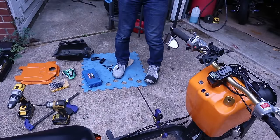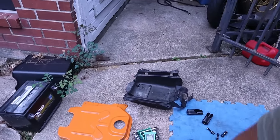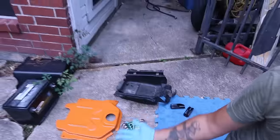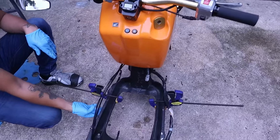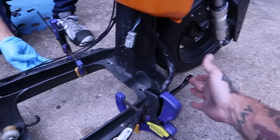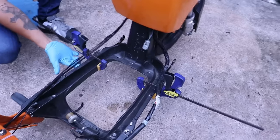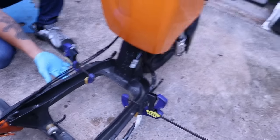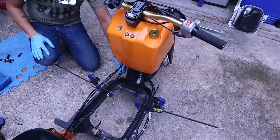What's going on guys? I'm going to go over what Cesar just did. First he unhooked the gas tank cover, then took the gas tank out, and you can see the plastic pan underneath. Then he had me stand behind and take some clamps to line up these brackets — one and then the other — for his front pegs, because he wants to copy me and do my front pegs. It's way more comfortable. Alright Cesar, tell me what do you do now?